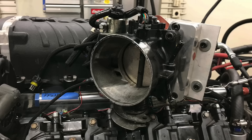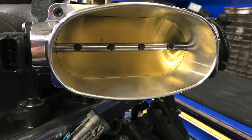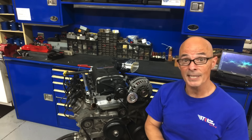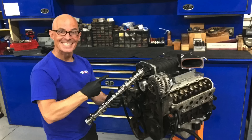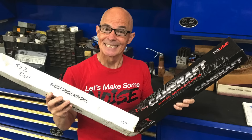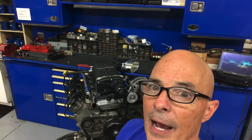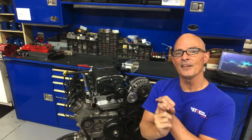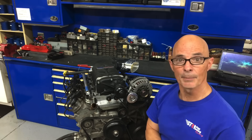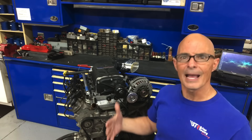We ran the stock truck throttle body, we ran a FAST 102 using all kinds of different adapters, and then I really stepped up to a big oval throttle body for a Super Cobra Jet from AccuFab. More testing coming up. In addition to the throttle body test, I also ran different camshafts — the Truck Norris cam and a Sloppy Stage 2 cam. We also found out what happens if you wire the bypass valve open and how much boost you lose. I listened to the 91-octane guys — I've got a test on 91 versus E85 and I'm going to show you the tune. Make sure to like, share, subscribe, ring the bell, and go out and buy all those GT500 blowers now because they won't be available after the video comes out.